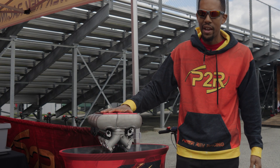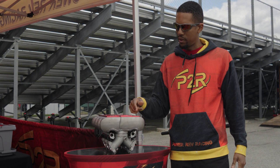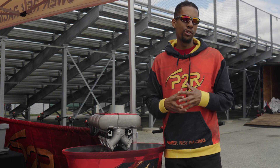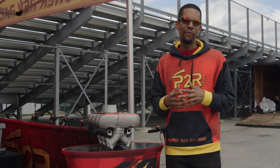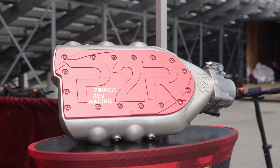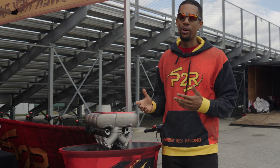This one right here will actually fit under the hood of an Integra or an EG. This manifold sits about three-quarters of an inch lower than a stock J32A2 or even a J37A4 intake manifold. So that's a major plus — no more cutting your hood, but also something that flows really well to help you make good power.